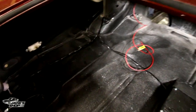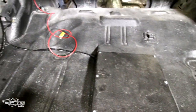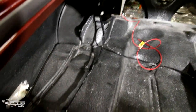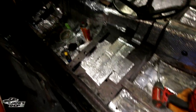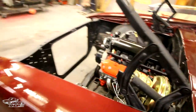I got it all tidied up. Doing your own custom harness like this is not for the weary. You can get pretty good kits online for this sort of thing, but I really like the Enos stuff and I like doing my own wiring — I really understand where everything goes. It's tidied up nice in there. I've got it wrapped where I want it. That red wire is going to be for a future amp remote — there will be a separate amp wire going back here for a decent stereo. Overall, the back is done. I've got one wire hanging out for my license plate cover; once that comes, I'll trim that out.